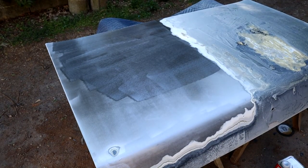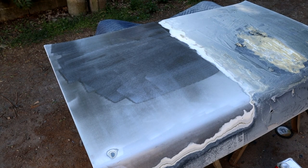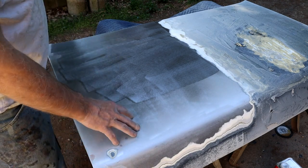There you have it — it does a good job. I was asked on the group by Gosta: why are we even stripping this back down? Well, with some cars you can give them a key sand and recoat, but with this car it's got so much on there that it's deformed some of the body lines. The only real way to do a good job is to strip all that off.